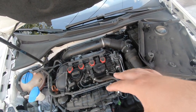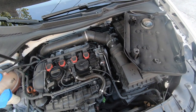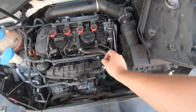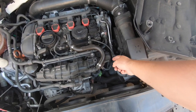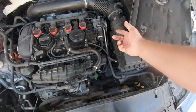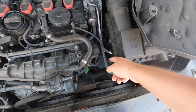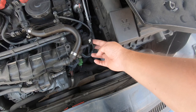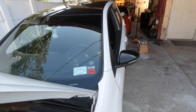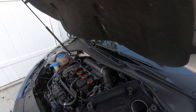In order to run the little boost pipe, if you don't want to pay the extra hundred dollars for the electric one, you can get an adapter here. You can drill into here and put a little hose and an adapter like this, or like they did here — there's a little place for an adapter. I don't like how they just left it like this though, it's pretty crappy, but we're gonna fix that. That's where we're gonna get our boost tap for the exhaust cutout.